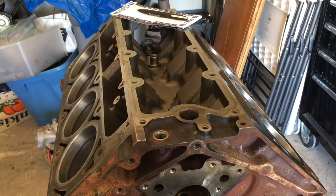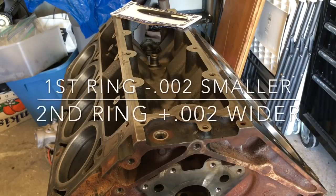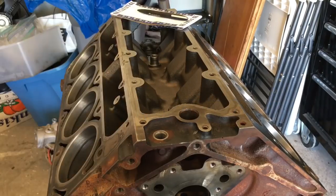Many people may not know: the more boost you throw at an engine, the wider your ring gap has to be. It's not uncommon to see 26, 28, 30, or 32 thousandths ring gap on higher boost pressure engines — but that's not a good combo for a daily driver. You're supposed to be plus or minus 2 thousandths on your ring gap, depending on whether it's your first ring or your second ring, to alleviate piston ring flutter under boost. There's more research to do to find out which ring needs to be what size.